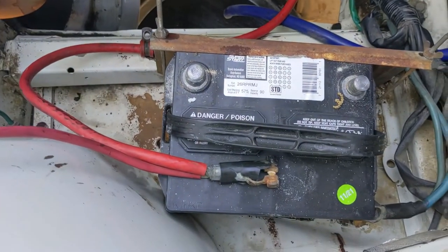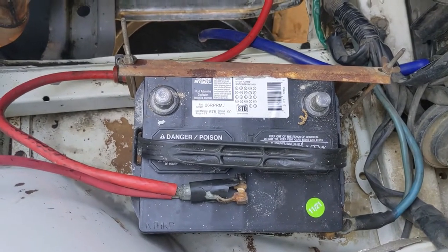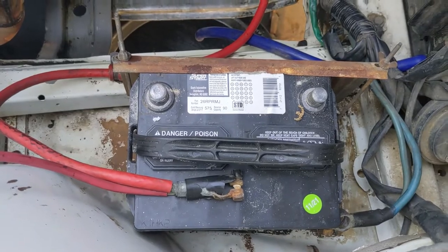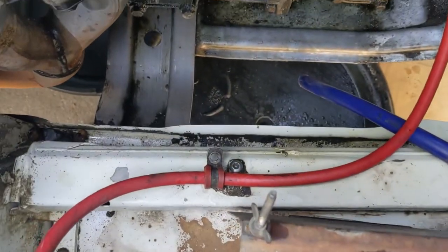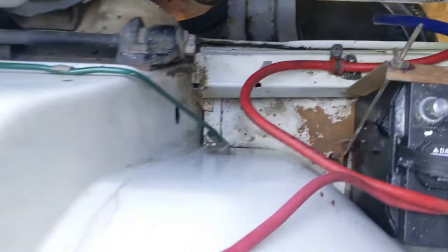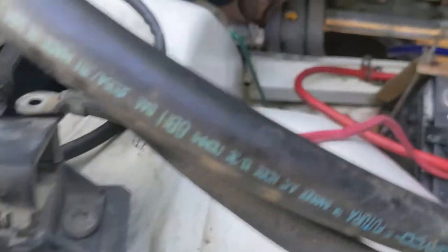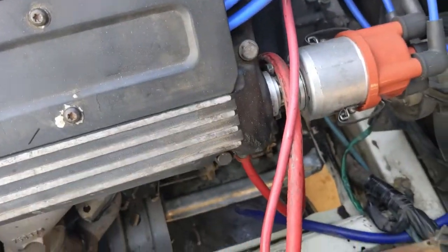While you're here, undo the battery — I do negative and positive. You don't have to do the positive cable; you can leave it in the car, but for me it's just so much easier to pull it out with the motor rather than fish it out later. Positive cable terminal done, clamp from the chassis rail done, disconnected from the junction box done. You can just take the battery cable and hang it over to the distributor so it can come out with the car.